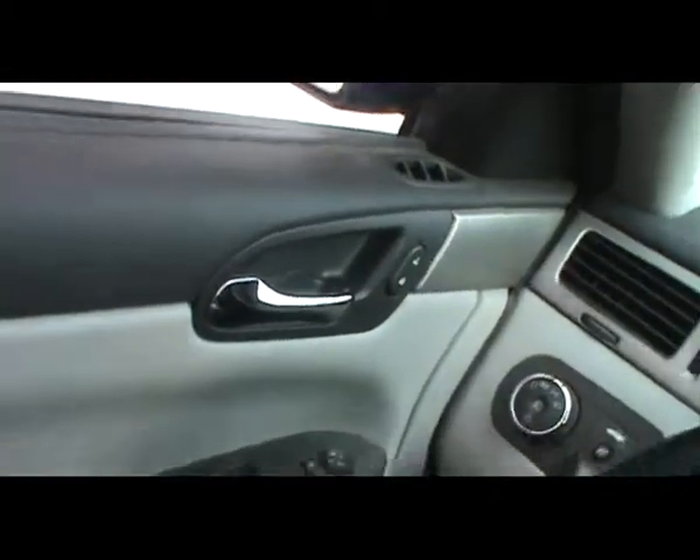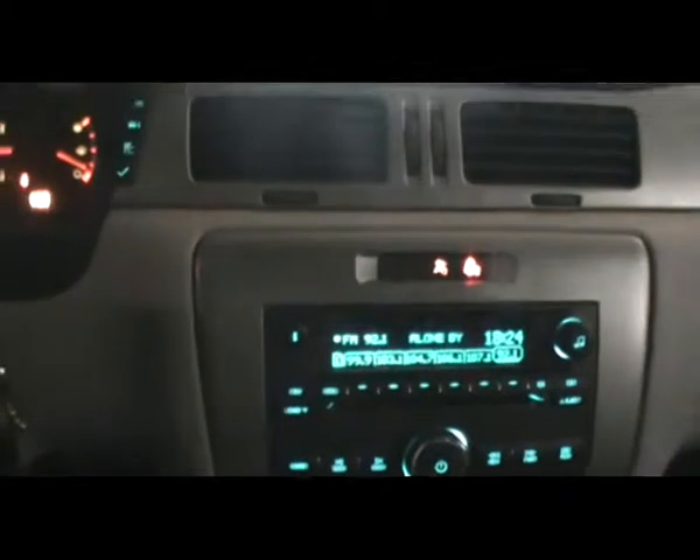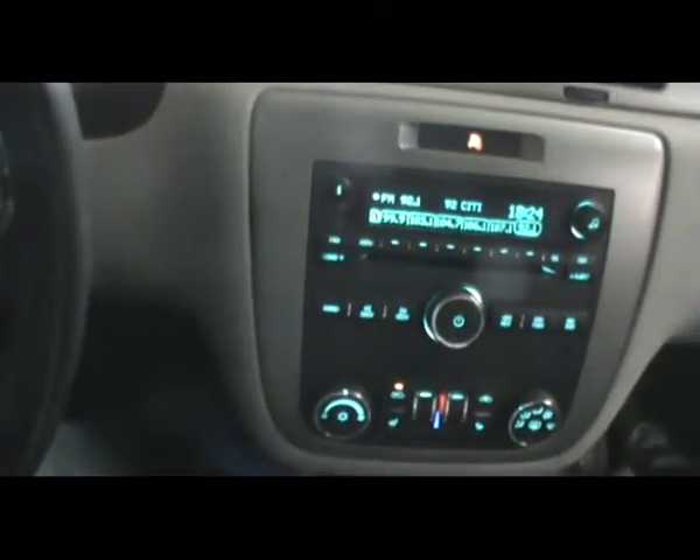Give me the camera so you can hear it. Just listen to the sound coming from the wheel — you're going to hear clicking noises. I don't know if you can hear these noises. It's like metal banging against metal. That's usually the ball joints or the tie rods. In our case, I checked it and the tie rods are gone.